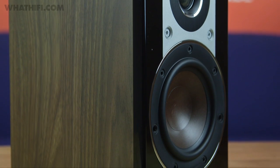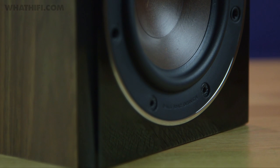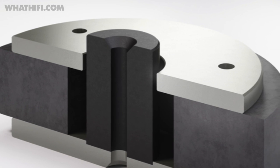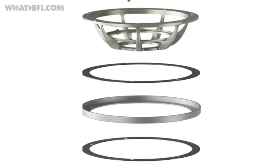As for their design on the inside, they borrow some technology from the company's high-ranging Epicon and Rubicon series. For example, the 12cm mid-bass driver is made from a pulp mix of paper and wood fibre, which aims to deliver a low surface resonance while also giving it its distinctive colour. This is flanked by a rubber surround that allows the cone free movement and is attached to an aluminium chassis that provides almost no interference to the magnetic field surrounding the magnet motor underneath. The magnet motor itself is made of a large ferrite magnet and a pole piece made from a unique soft magnetic compound. This is then secured between two soft iron plates to create a close to optimum environment for the two-layer voice coil to work within.